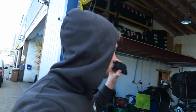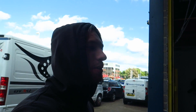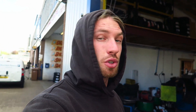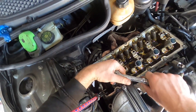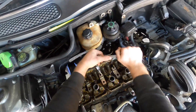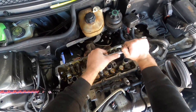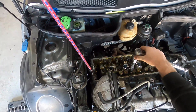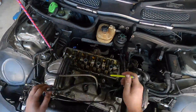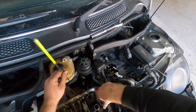It's ten past two — we're just about to take off all the head bolts and pull the head off. We're just a bit behind schedule. We wouldn't have been if I didn't run into that issue with that stud. Getting the head bolts off bit at a time in a star pattern. I'm not really happy about using a multi-point socket but they're coming alright. I'm very intrigued to see the head gasket — it'd be good to see if we have like one piston which is super clean. God it stinks so bad — like burning, like burnt something.